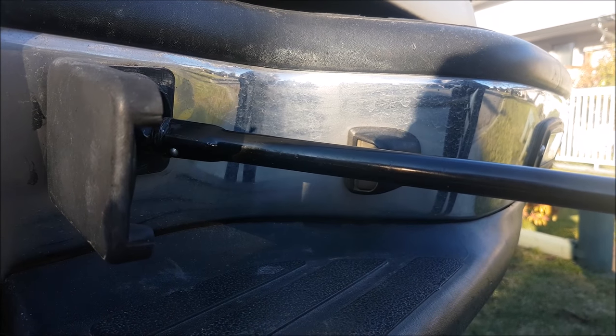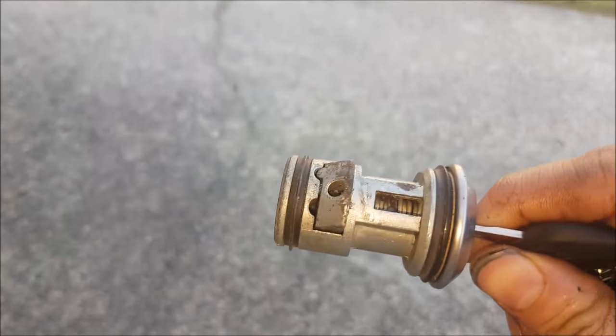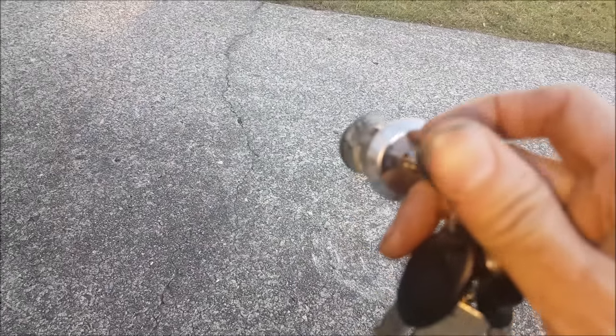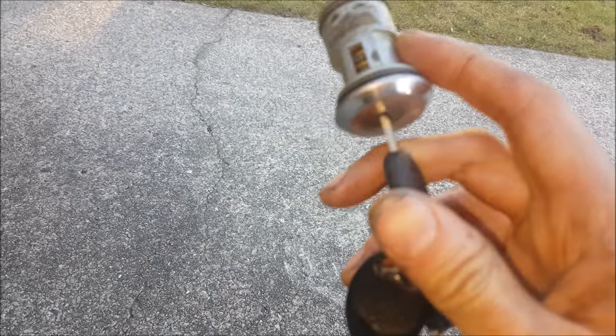Not fully locking it is what's inducing the problem of it triggering the safety lock. Also take the time to lubricate the inside of the lock cylinder — that way it doesn't get sticky. If you never lubricate it, it gets wet in there and in really cold weather it can ice up. If you spray something in there designed for locks, you'll never have an icing issue.